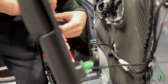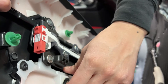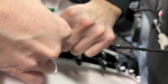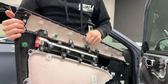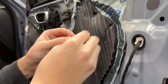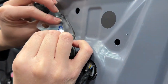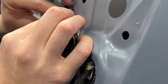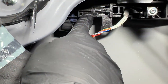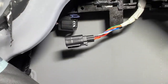After that there's just one more harness I've got to take out — and I should be able to get this out without cutting it. Just like that, now the door card's off. I'm taking off this inner liner too: there was a little clip I took out, and I just peel this back — there's a lot of silicone so I'm going to throw on gloves. There was a white tab over on the left; I just flipped it to the right and that releases the whole handle.